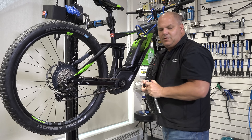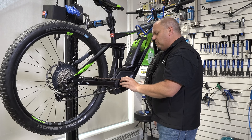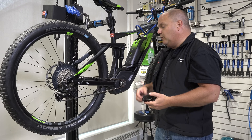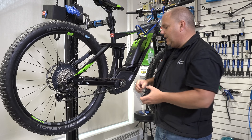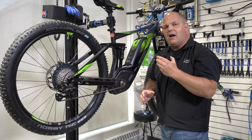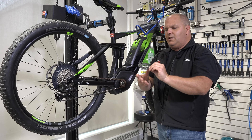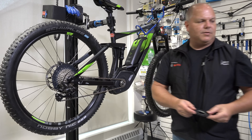Now I am loose. I'm going to take this to the side and should be able to do this by hand now. If you have an older version that's been exposed to a lot of dirt, it may be more difficult. You may need somebody to hold that rear tire as you push against it and crank down on your ratchet set — that will crack it and allow it to loosen really easily. That's what the chain ring lock nut looks like — put that aside.